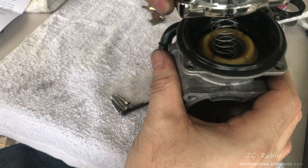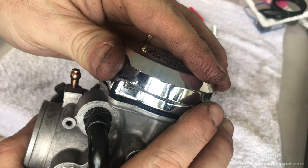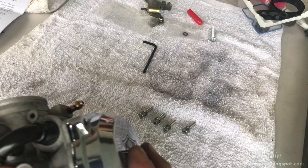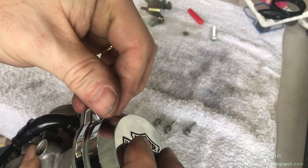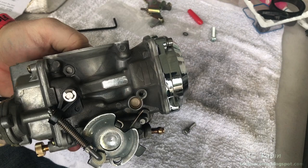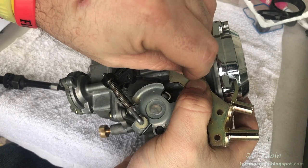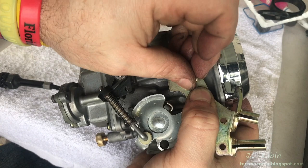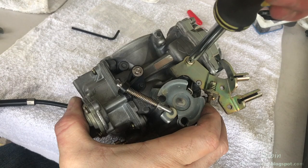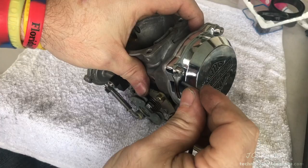The jetting kit has new screws with hex heads, so I'll be using those. The notch of the cover holds the spring centered as the cover is lowered onto the carb body. The detents in the cover close in a certain position — I give a shake as I close it to drop the gasket edge into the detent of the carb body. Turning and inspecting to make sure it fell in properly. Holding the cover, I put the first three screws in. I will not be putting in the screw that holds the bracket yet. Now placing the throttle cable idle bracket on the side and inserting that side screw, then releasing throttle stress off the idle stop before snugging the screw down. Finally putting in the fourth screw up top and torquing all screws down with a nice snug.